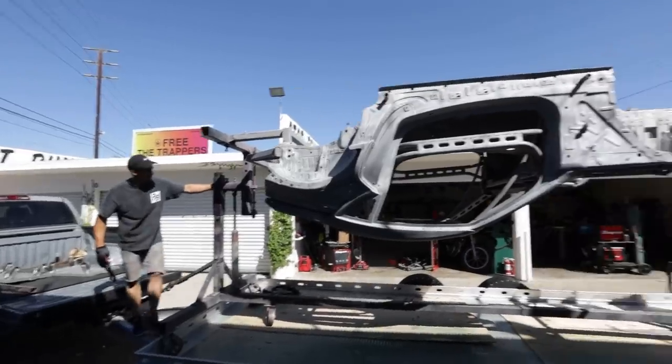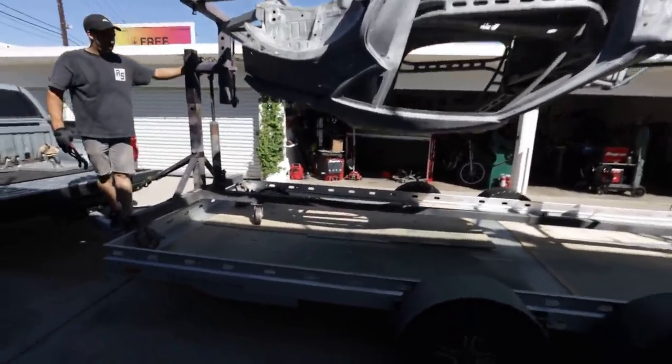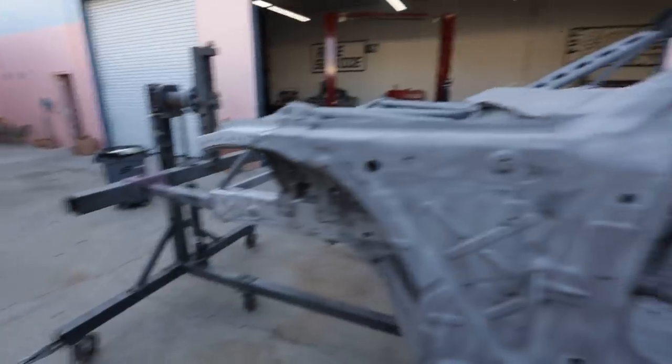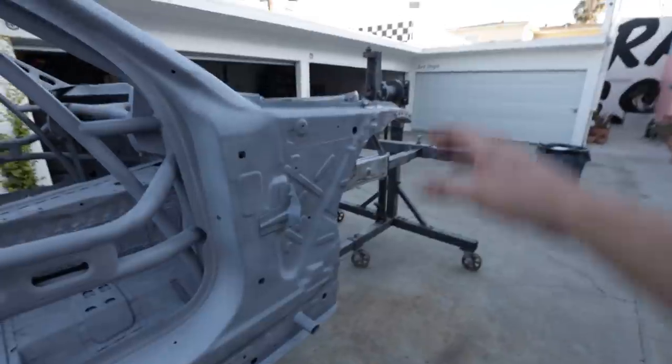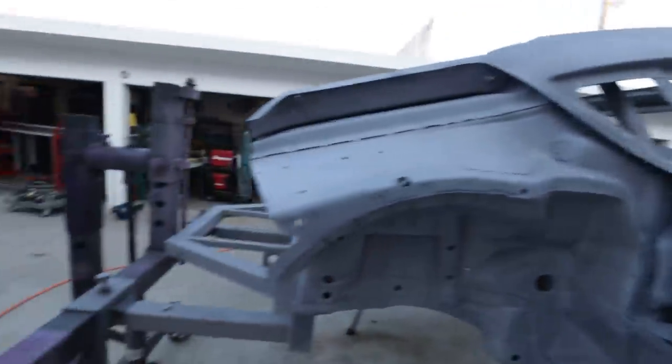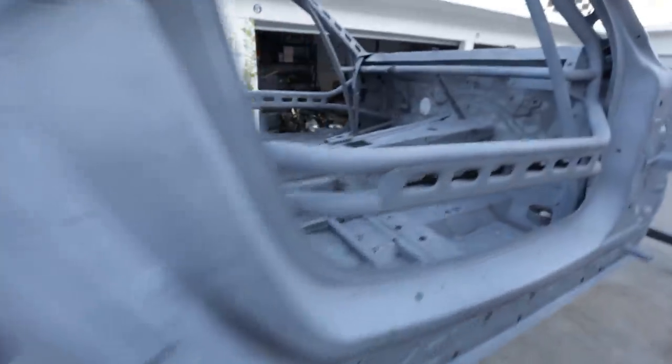Throw me that bar. Oh, hell yeah. We are in full chassis paint prep mode. Yeah, so we used a gray Scotch-Brite pad to rough everything up and then dusted on some etching primer onto all the bare spots. The sandblaster did not get every single area of it, so we are having to go through it and re-prep some surfaces. This side is just dusted a little bit.